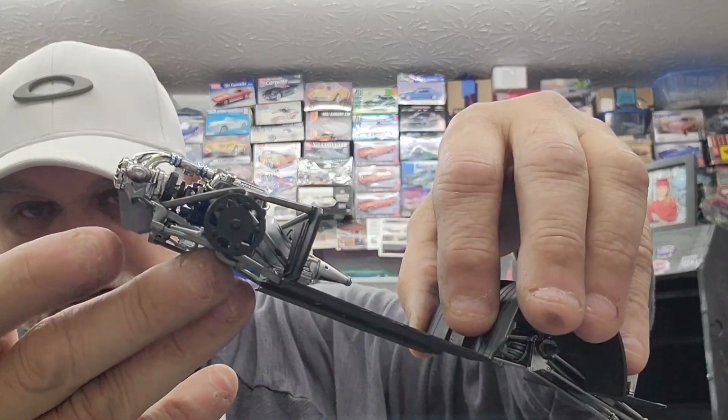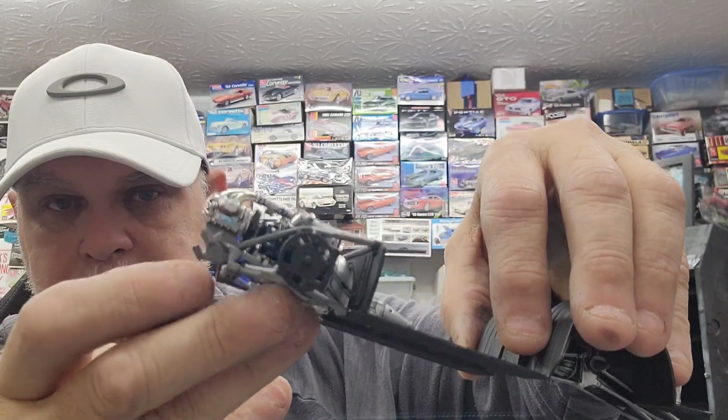Our exhaust is where it needs to be, and it does sit underneath the hood, guys. So can it be done? Yes. Remember the intake box we shaved down about 1/8 of an inch. Everything else lined up, the belt assemblies and the blower and everything. It's just this has got to be shaved a heavy 1/8 of an inch off the bottom to get it to where it would be.